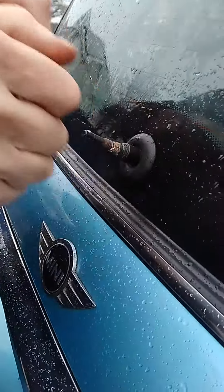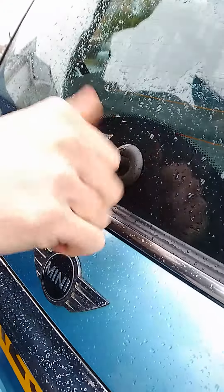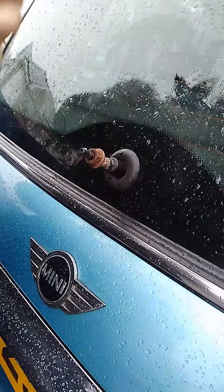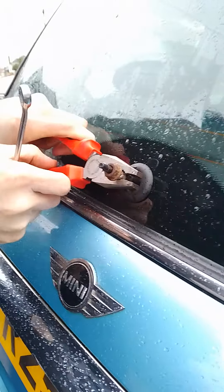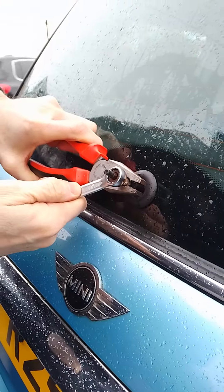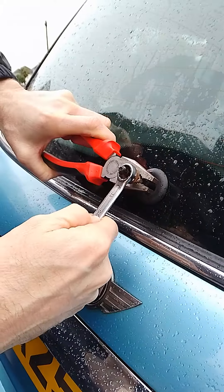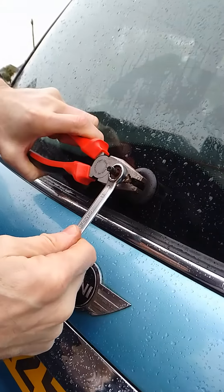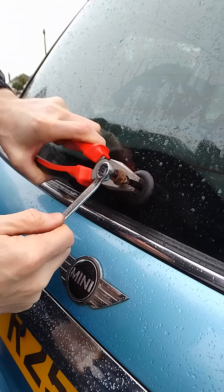When I took the old one off, to get the nut because it was so seized on, I recommend that you grip from behind and embrace it with equal measure — clockwise on the pliers and anti-clockwise on there — just so you don't damage the weak mounting behind.